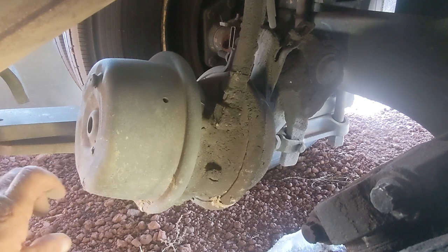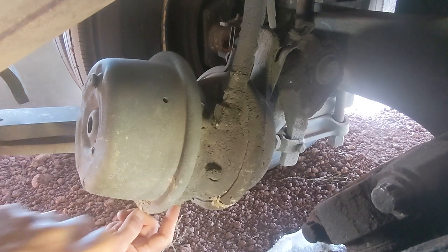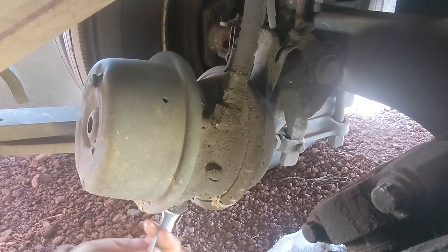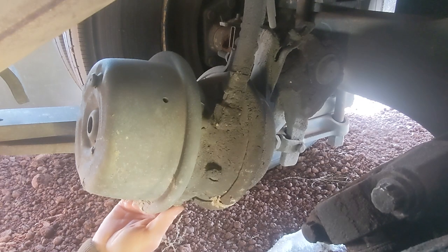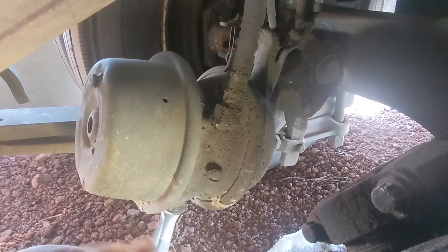We've got to get something in this hole — normally they have a rubber plug in them, but these are missing. It's called the caging bolt, and that's what I showed you on the bench. When I go pick up a bus I always take a couple of caging bolts with me because I don't know if they're actually present. In this case they are here, mounted on the side of the canister or cylinder. But they get used and sometimes they're not replaced. I'm going to use the one that's on the brake here because it will go away with the tow truck when they come.